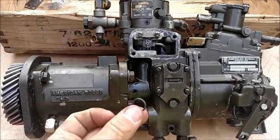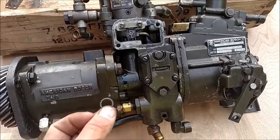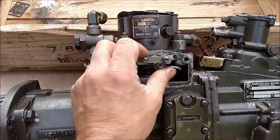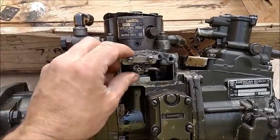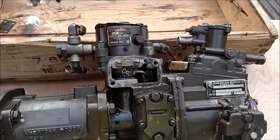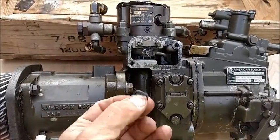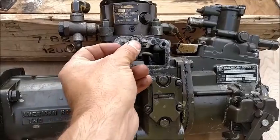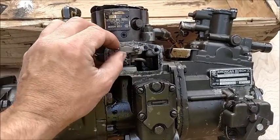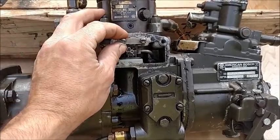This little O-ring, this one is the one that gives everybody trouble. That one goes on here on your fuel shutoff. And as you can see, this does not return the way it should. And the reason for that is when you put this little bitty O-ring back in on the shaft that's under here, these 2 screws cannot, I repeat, do not tighten these 2 screws.